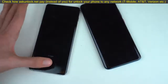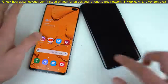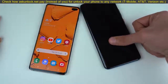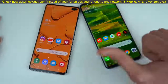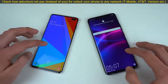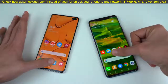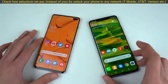One thing I've noticed is that with the Galaxy S10 Plus you don't have to press the display at all — you just have to place the thumb at the surface and it unlocks the phone. Whereas on the Mate, because it's optical and uses the screen light to read the finger pattern, I have to apply a bit of force for it to actually read the fingerprint. That is the difference between the ultrasonic and the optical scanner. Let's unlock at the same time — and the S10 Plus is a bit quicker, just a slight difference in speed.